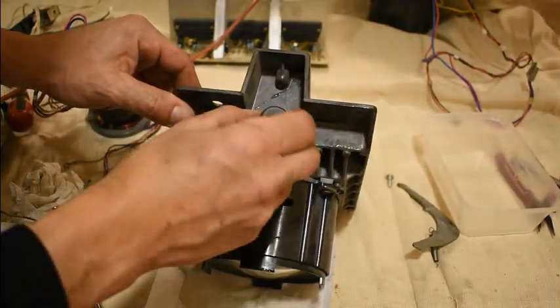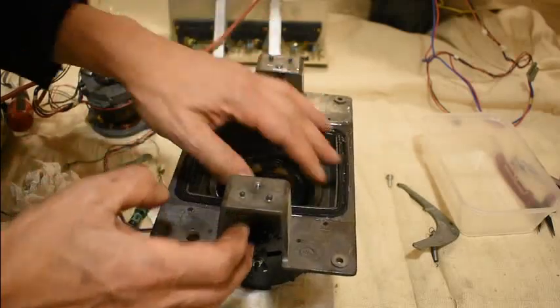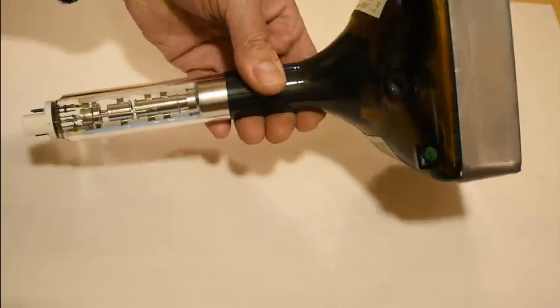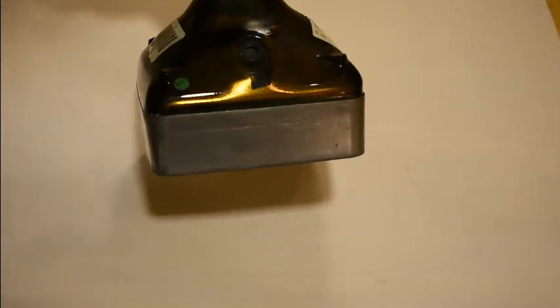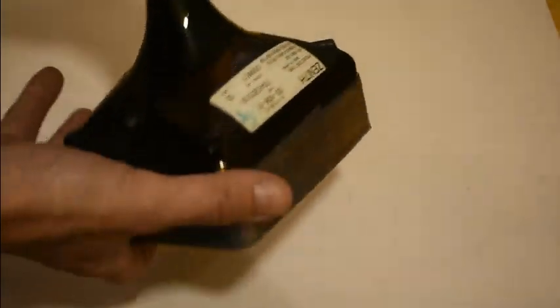This is the lens assembly, and if I take this cover up, this is the little expansion bladder for the coolant that sits inside this reservoir. The green CRT is removed for closer inspection — you can see the anode connection and the burn on the phosphor, plus a little extra burn from when the beam current was slightly higher; a stationary spot on phosphor burns pretty quickly. The glass is also loaded with some sort of heavy metal — the coating should be silver but something is colouring it, presumably part of the X-ray shield. It could be lead or another heavy metal, perhaps barium.